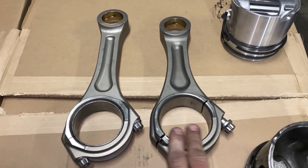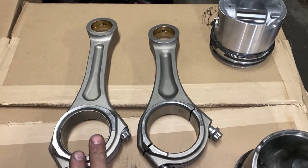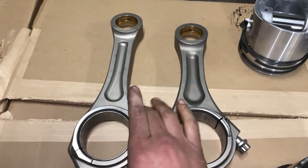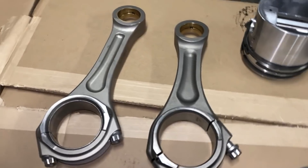The real benefit of the one-inch longer rod, in my opinion, is a better rod angle. Both of these rods do 6.7 displacement with a 6.7 piston and 6.7 crank — that one-inch longer rod comes from the deck plate. At its absolute best, the one-inch longer rod is a one-and-a-half degree angle improvement over a standard length rod. One and a half degrees isn't a lot, but when you're talking about the acting force on the piston, Meyer has a formula that calculates to about 40 pounds less acting force with that rod angle change.